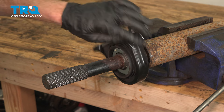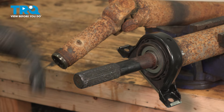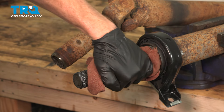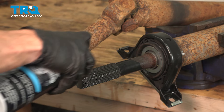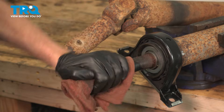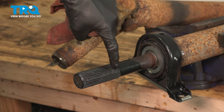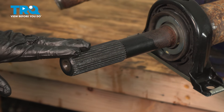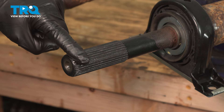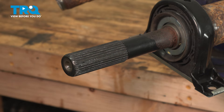Give this a spin — that's a lot better. Let's continue cleaning up this area, including the splines, to remove any miscellaneous debris. We'll use some parts cleaner and a rag. Quick inspection to make sure nothing's rotted and damaged. This is very important. Let's pre-lubricate this with some high-temperature lubricant — we want to make sure we lubricate along the splined area and also down closest to the tip. That will help this slide onto the seal and help the seal slide into place.